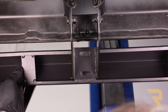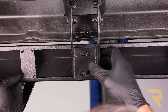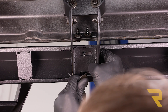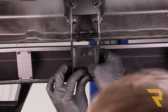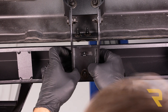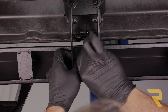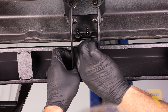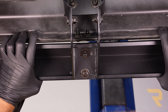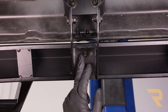Once you've done this to all three and hold those bolt plates in place, we can go ahead and line these up to our brackets. Now we're going to take our running board and line it up to our brackets, very gently lower the bolts into the brackets. Once they get lined up, we're going to take our supplied hardware — bolt, lock washer, and flat washer — run through the bottom of our double bolt plate here going into the welded nut. Then come up top and do a flat washer, lock washer, and nut on the bolt coming out. Do that to all three of our brackets. Once all three are in place and lined up, go ahead and raise up the board, get it lined up where you want, and tighten everything down with a 13-millimeter. Repeat the same for the other two brackets.